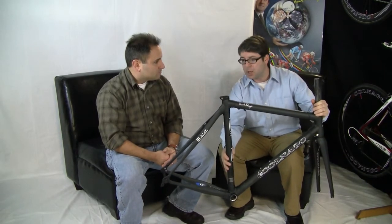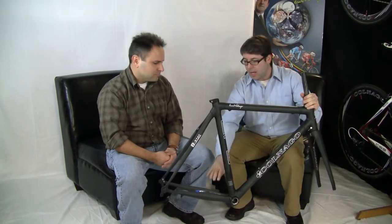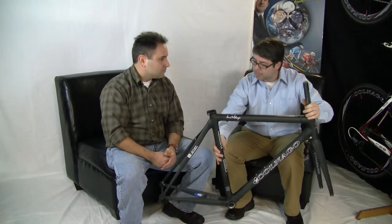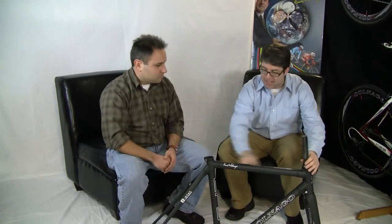It comes back in the line this year, but the main changes we made are on the main tubes and in the stays as well. The front end basically remains mostly the same. The main thing about the tubing — which you cannot see — is the internal ridging and the structure we give the frame that provides its lateral rigidity, which allows us to make a very vertically compliant frame, a very lively frame, but one that braces the bottom bracket a great deal for wonderful performance.